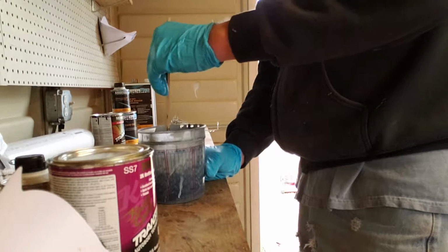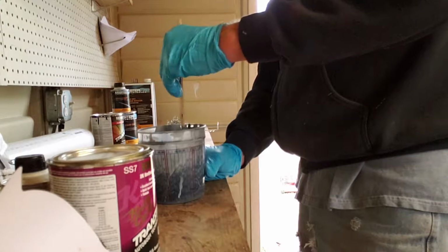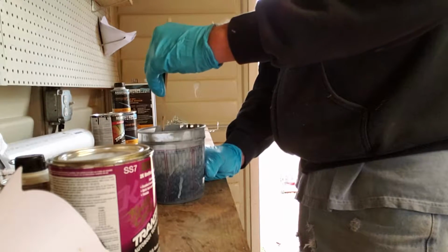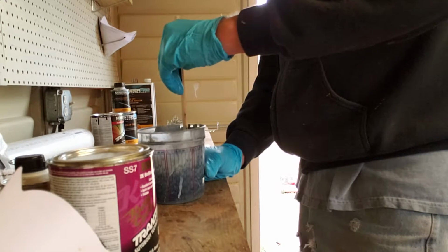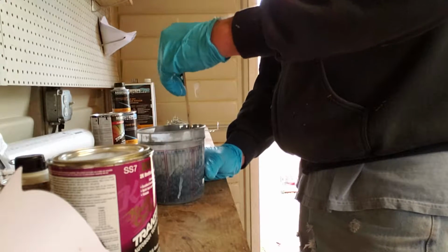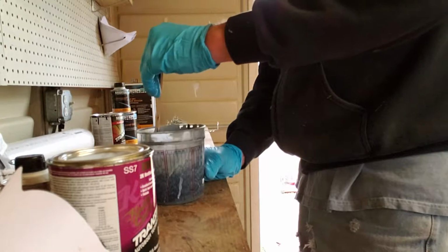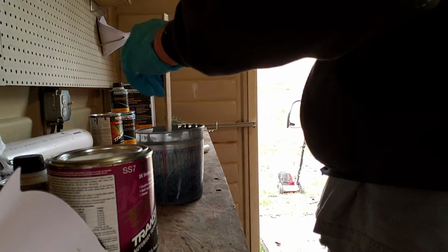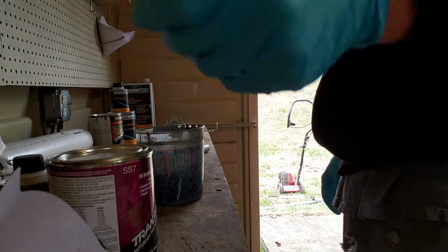I like to go ahead and get my paint, sealer or primer, whatever it is that I'm fixing to spray, ready and in the gun. That way, after I tack off whatever it is I'm painting, I can turn right around and grab the gun and go to spraying. That way there's not as much time for something else to land on my paint job.